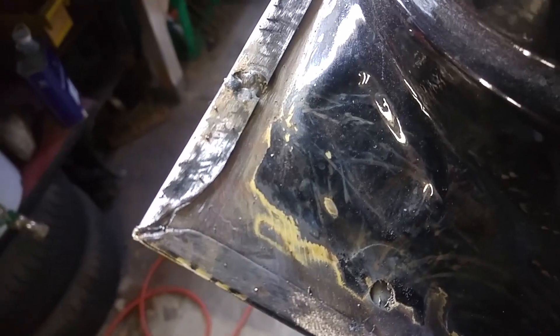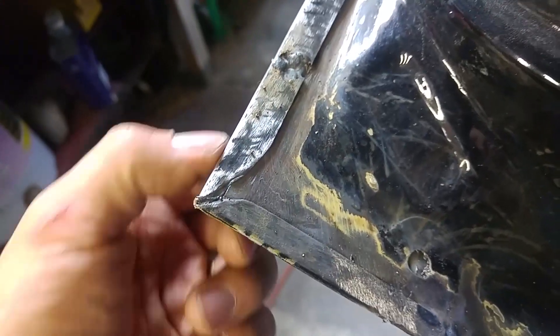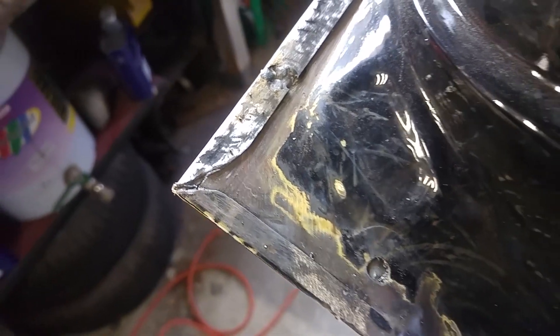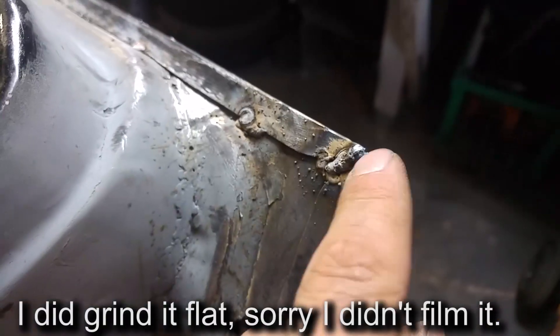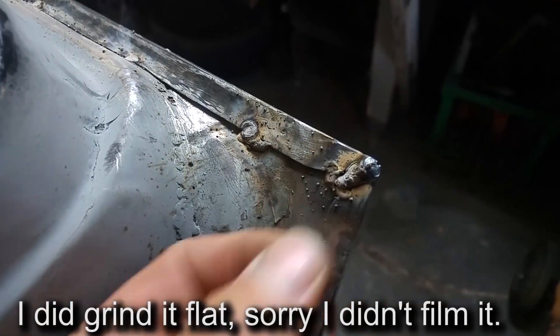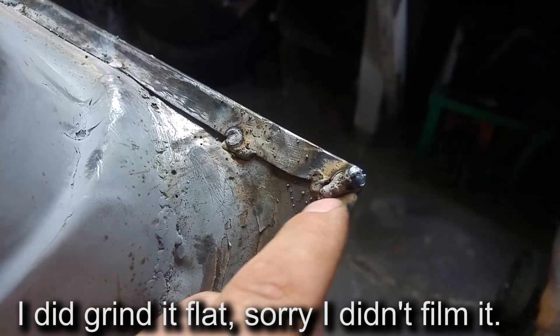After a buzz with the sandpaper disc in the grinder they've come up very smooth. The corners — I'm going to put some weld on them because they look horribly delicate and seem to be a sharper corner than the factory panels. It's a bit heavy but that'll be solid. I'll be able to file a little roundness into that corner, and it'll be a nice solid piece of steel — that'll be strong.